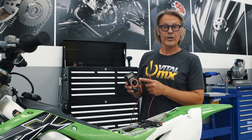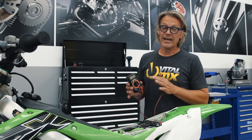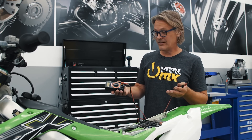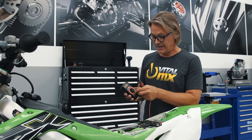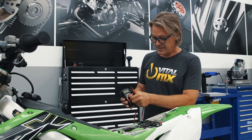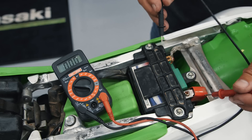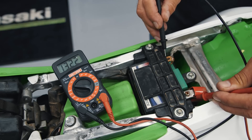To test your battery, it's a good idea to go out and purchase a voltmeter or multimeter. You don't need an expensive one — you can buy a $10 voltmeter at Harbor Freight or Sears and you'll do just fine. Switch it to DC volts to test your battery, then put one lead to the positive terminal and one lead to the negative terminal.